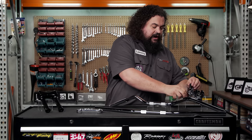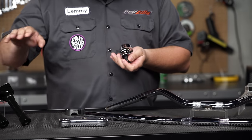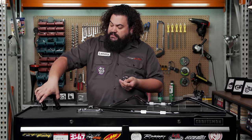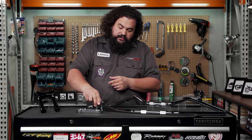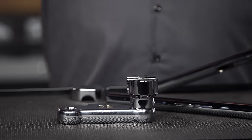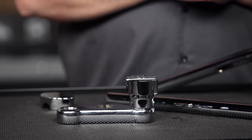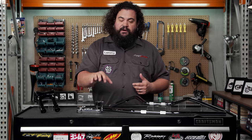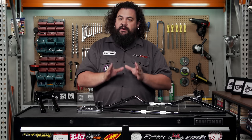This also extends to the risers. These risers are specifically for a Springer. With hydraulic risers, the bolts go up inside the threaded pieces. With a Springer, the risers set on top of the top clamp and the bolt actually comes in from the top, then the bars sit on top, and then the riser top clamp goes on — it's a totally different setup. You can use some Springer-style risers if you have a hydraulic front, depending on how your bike is set up. But if you have a Springer, you need Springer risers specifically.